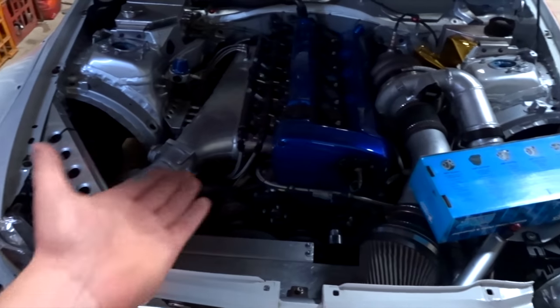And I'm just gonna give you a quick rundown of how this is actually inbuilt into the cooling system. Because most of you guys know that the radiator is actually in the boot. So, long story short, first thing you have to do is rip the factory water pump out, and that is behind here, you can see that I'm pointing at. So what we do there is we pull that water pump housing off, actually take the fins off of the back of it, so completely remove them. It still looks like I'm retaining the water pump, the factory one, but there is no fins in there.